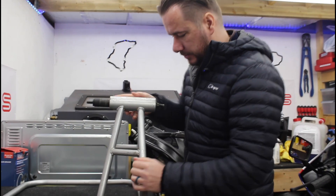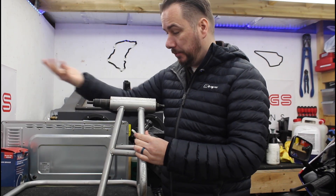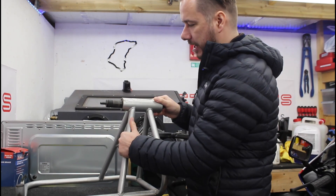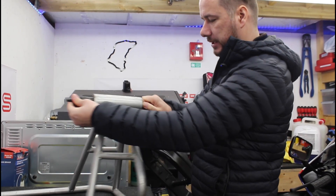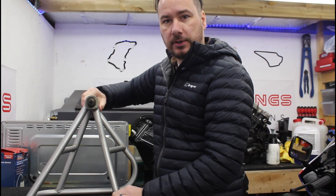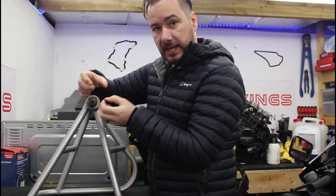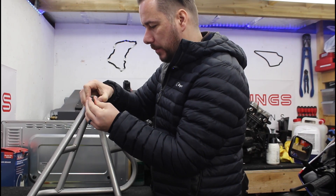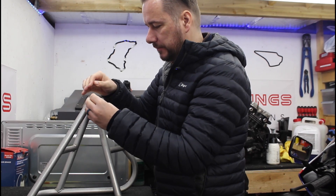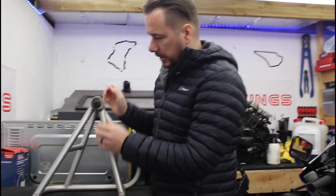Now you can look at the sort of triangulation I've got in with the supports here. Bear in mind you've got all that weight of the motorcycle getting put right through this axle. The way this works is: this goes through the centre axle, you tighten up this nut here, and then it increases the cross section of this rubber bung, and that then grips the inside of the rear axle. Now that rubber bung is not new, so I'll test it to see how much it deforms and grips. And if it's not enough, I'll get it replaced — I'll get a part made.